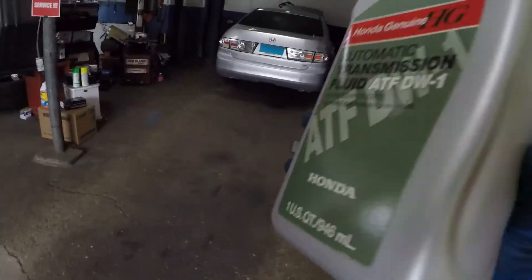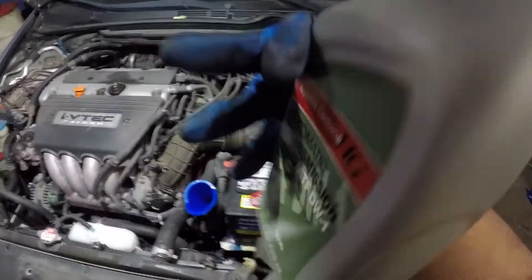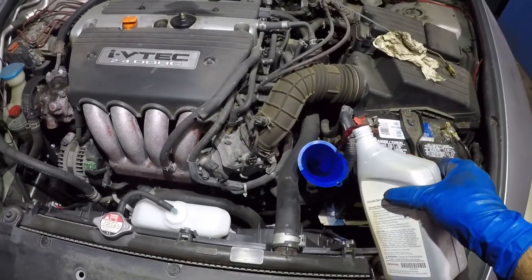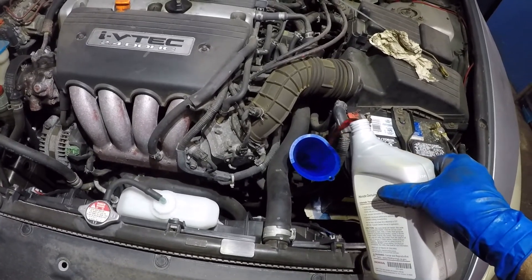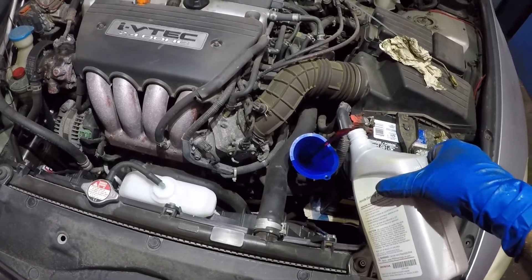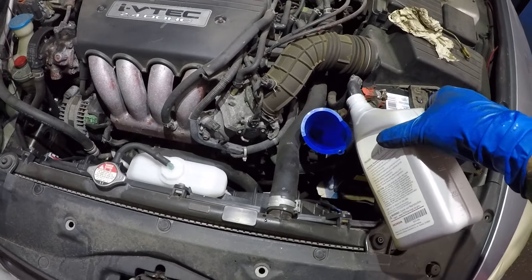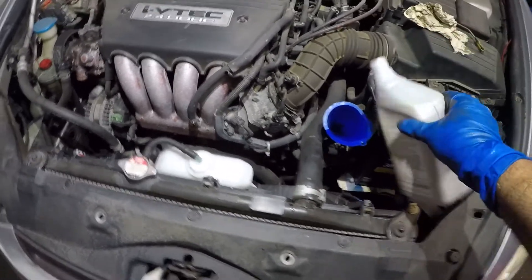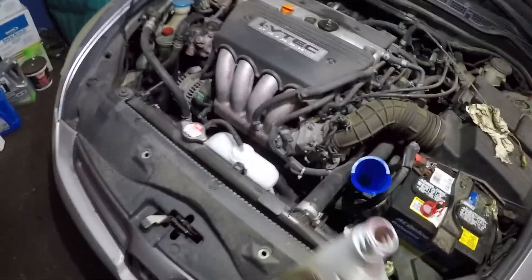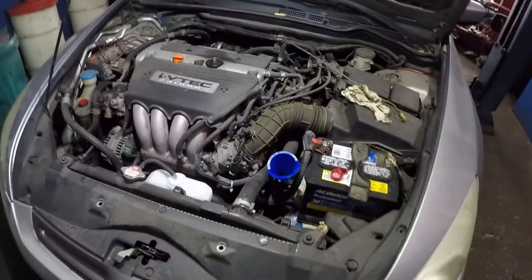This is where I keep my transmission fluids — and there's the one I need. Use the original OEM fluid — it's only about six or seven bucks from the dealer. Open it up and pour the whole bottle in. After that, let your car run, let it heat up, and check your fluid level. If you lost a lot of fluid you might damage the transmission. If you haven't done your transmission flush, this is actually the best time — drain and fill. Go slow and pour carefully — there you go, perfect. Check your transmission fluid level, make sure the car is on a flat level surface with the engine running and warmed up. That's it — thank you for watching!